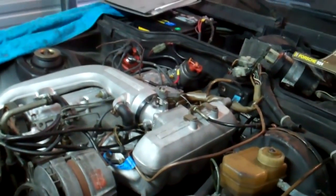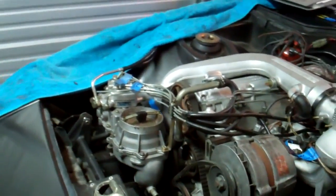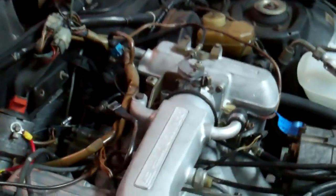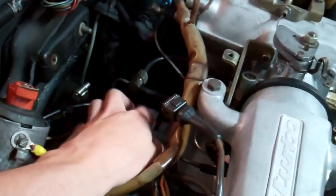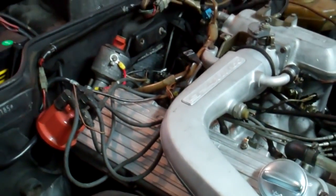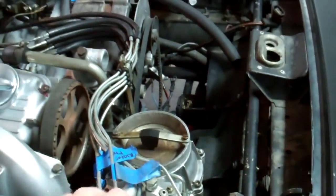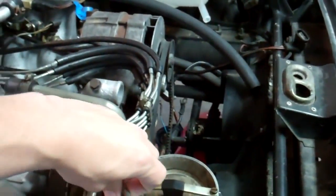The ignition system is all plugged in and it works. The fuel system is kind of plugged in — it's almost there — but there are just a few fuel lines that need to be connected, like some back here that connect to what I think is the warm-up valve. Also, this car actually has two fuel pumps: one in the tank and one right outside the fuel tank to boost up the pressure, because this thing runs on, I think, around 100 pounds of pressure — that's why the lines are hard steel like that.